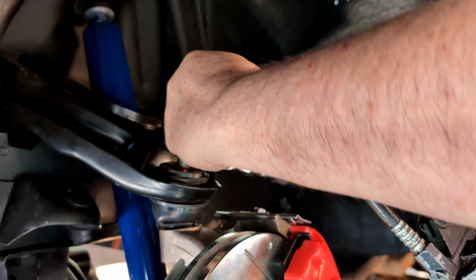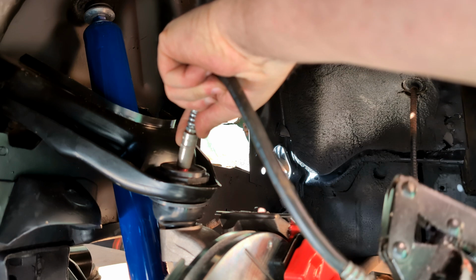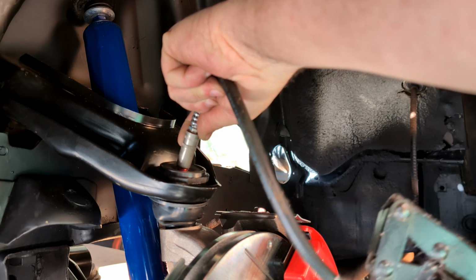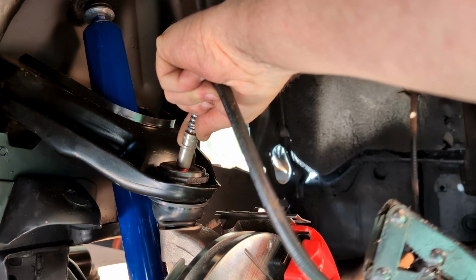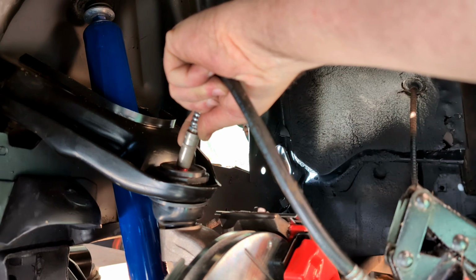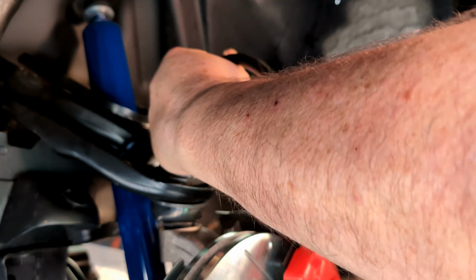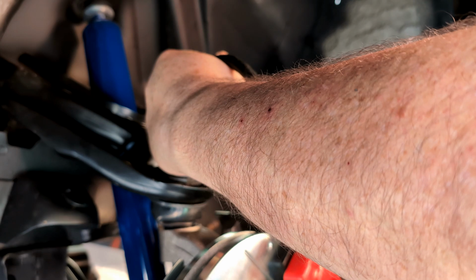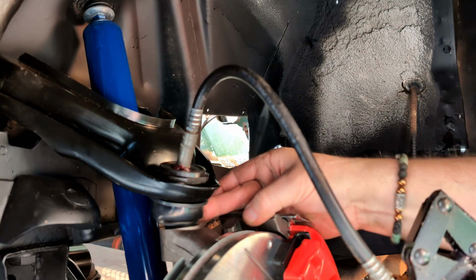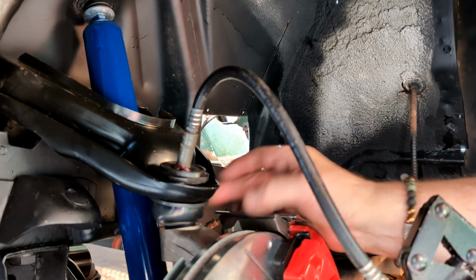Now, one thing, when you're putting grease in these, you don't fill it so it pops. You fill it so you can start seeing it bulge out. Go kind of slow. I may need to add some more grease to this. I can start feeling it in there. Yep. A couple more squirts and we should be done. Yep, if you can push on one side, see it move on the other, that means that's grease and not just air. All right, we're good.